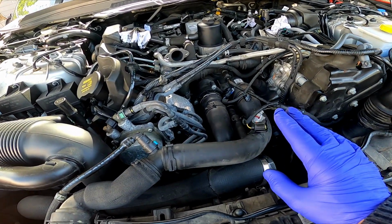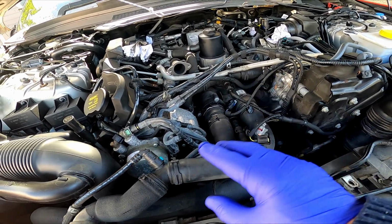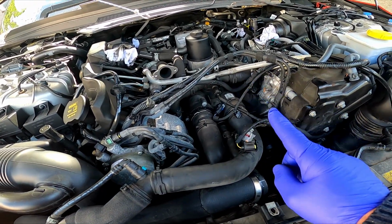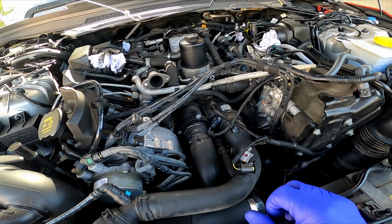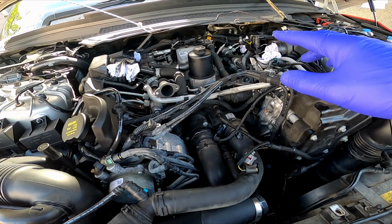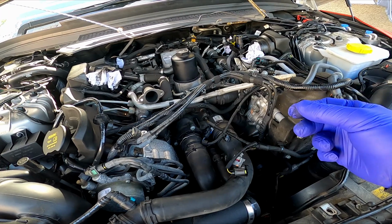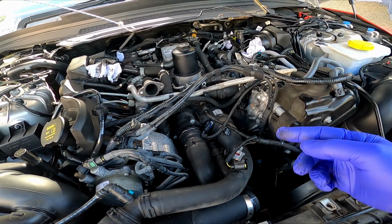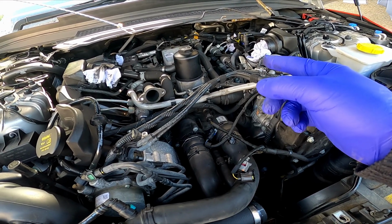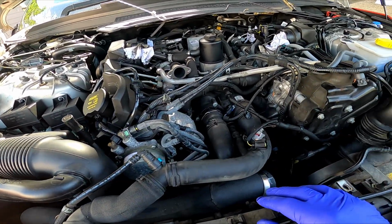And what you tend to find is sometimes you may have oil seeping from the turbo, coming up through the intercoolers and into the inlet. We've also got the PCV, positive crankcase ventilation, coming up. Positive crankcase ventilation will contain diesel particles and oil particles, and it's being fed back into the engine. However, this engine does have an oil separator. Sometimes you would use a catch pot or a catch can to try and catch that.